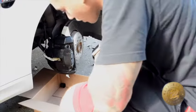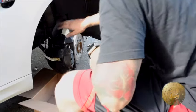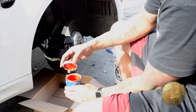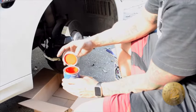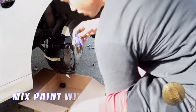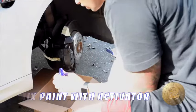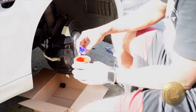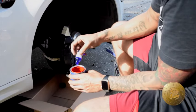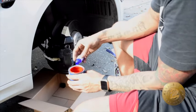Alright guys, I have the prep and everything taken off. Try to watch out for the rotors. This is the paint right here — got that nice deep red — and this is the activator. Now with the activator, you want to make sure you get a good mixture, make sure you get it all in. From what I was told, it works with the other paint for a good four hours, then after that you pretty much can't use it, so you've got to make sure you get all the calipers painted within that time frame.